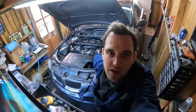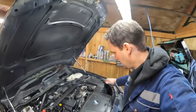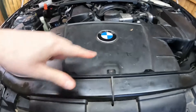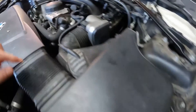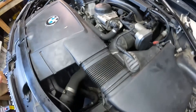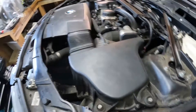Unfortunately I think that's going to mean the intake manifold comes off. It's not a waste of your time - you can get on with it. I've got some instructions that I'm going to follow for this. The first thing to do is remove the air intake box, and for that we're going to remove the torx screws there. One's missing from there because it snapped a while ago. Some trim clips there, clip around the intake piping, MAF sensor plug - and then that should come out.